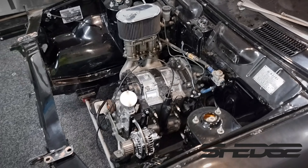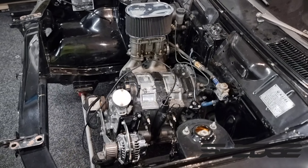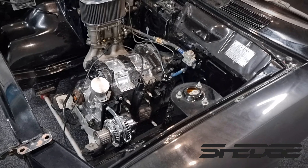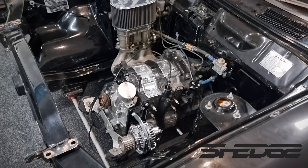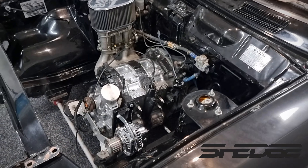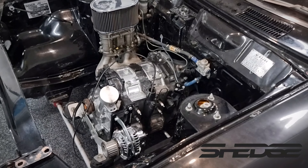So what we're going to do with the engine bay — I've already ripped a lot of stuff out. I'm going to be making an oil cooling radiator from scratch. It's going to have all hidden lines and a hidden water pump — it'll be an electric water pump but you're just going to see the two lines; you won't actually see any water pump in there. I've converted it to a crank angle sensor setup. I've already had it up and running and it seemed to run really really well — I was quite surprised, actually, on an old school Microtech.